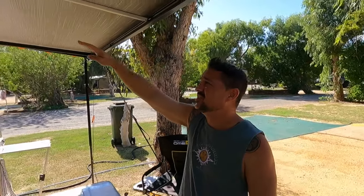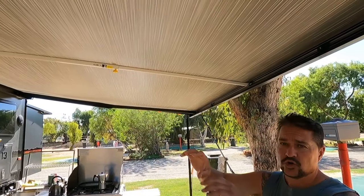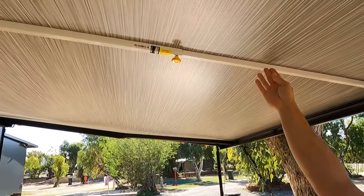Awnings are a hot topic when caravanning and probably the one thing you're going to break on an extended trip. When we were recently at Margaret River we came back and our awning had fully collapsed. I don't think it was a quality issue — we got a freak storm that wasn't forecast: 40 mils in half an hour and it just couldn't cope. We're going to replace this awning when we get back to Brisbane — I want a good quality one like a Bundatech. But to get us through to the end of this trip, we've added one of these super peg curved rafters, about 35 bucks from a camping shop.